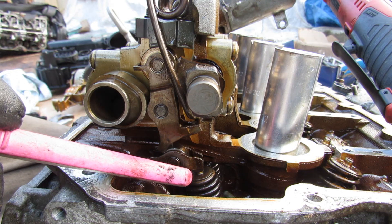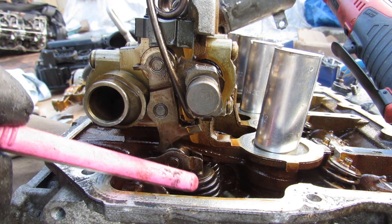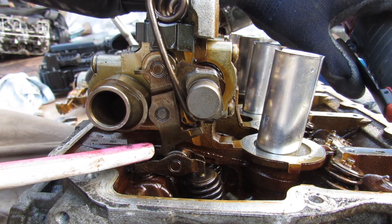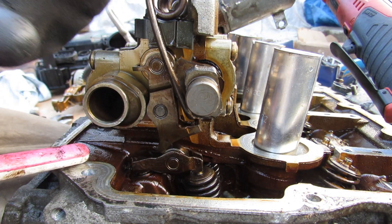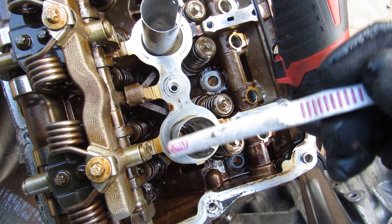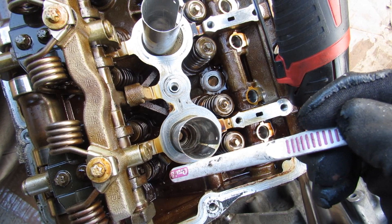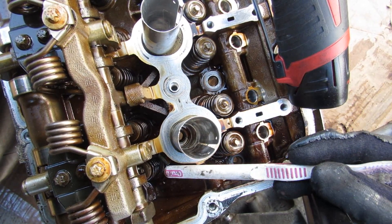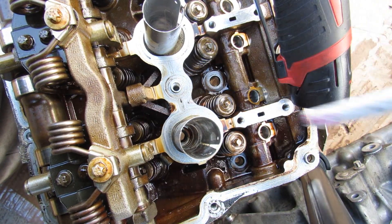In this setup you can get about 0.18 millimeters of minimum open valve and 9.9 millimeters of maximum open valve. Although it seems slow when I move it, this actually happens a lot faster because it's powered by this heavier motor, which powers all 12 valves on the intake side. These two valves on the same cylinder are actually timed slightly differently — one opens a little bit earlier than the other — but once you're at max throttle they both open the same amount, which you can tell because this spring is a little wider open than this other spring here.